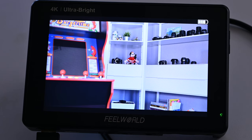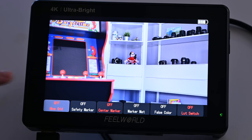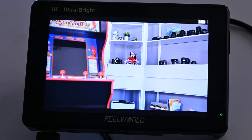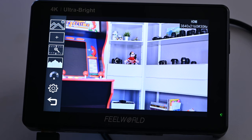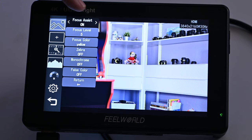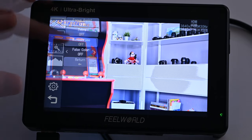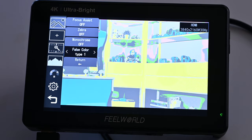So I've got it hooked up to our Z7 here in the studio. I've got the HDMI in the bottom, and there are three function buttons across the top, a menu button, and a power button — but it's also a touch screen. There's a quick menu swiping up from the bottom of the screen with some key things you might want to change. You double-click to get the main menu up on the upper left-hand side. Focus Assist works very similar to a mirrorless camera where you can set the color you want and how picky you want to be about focus. You can do zebra stripes for exposure and hot spots, and set the zebra value — 80% to stay safe on highlights, or 95% to 99% if you want to be more aggressive. Down here is False Color, which gives you different colors for different luminance values in your image. Skin tone you want to be gray, blues and purples for lower values, and red as you get higher.